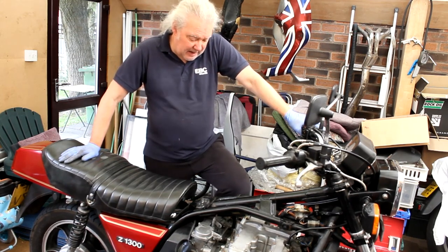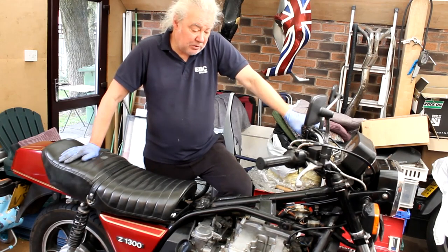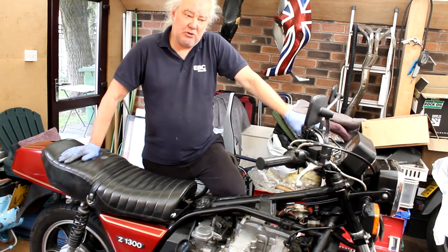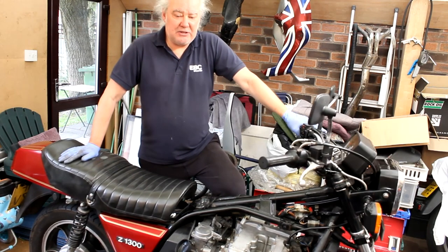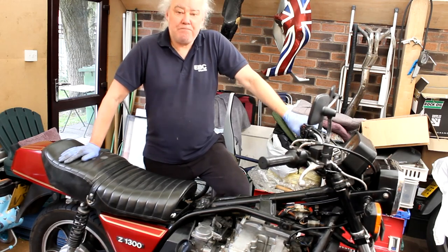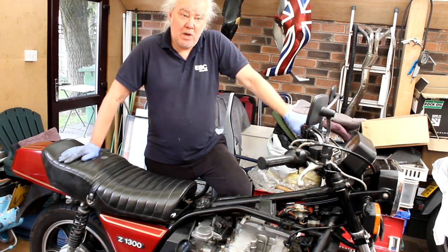I've come to the point where I thought I'd have to put all the original carburetor bits back in, but I found two of the ignition coils were cracked, which is a common thing on these. And the upgrade is to fit Honda coils, would you believe? Right. Looking at the forums. So I've done all that, and it runs better, but it's still not right.